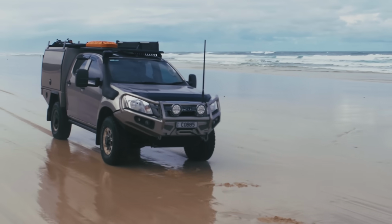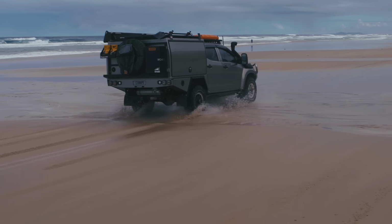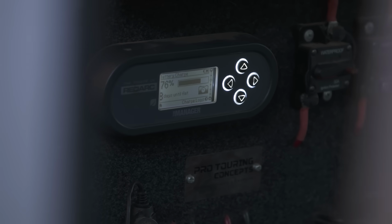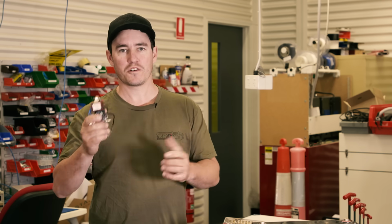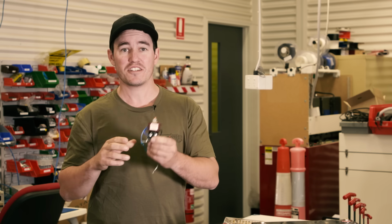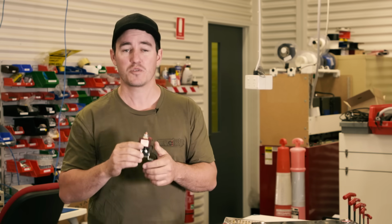What this means is the alternator will vary the amount of voltage it outputs depending on the engine temperatures, vehicle loads and driving conditions to reduce load on the engine, which saves fuel. They can vary the amount of output from 12 to 15 volts. Most isolators will turn on and off depending on what sort of voltage supply they're given. So this one in particular will turn on once the volts get to 13.2 and will turn off and stop charging once it drops down to 12.7.